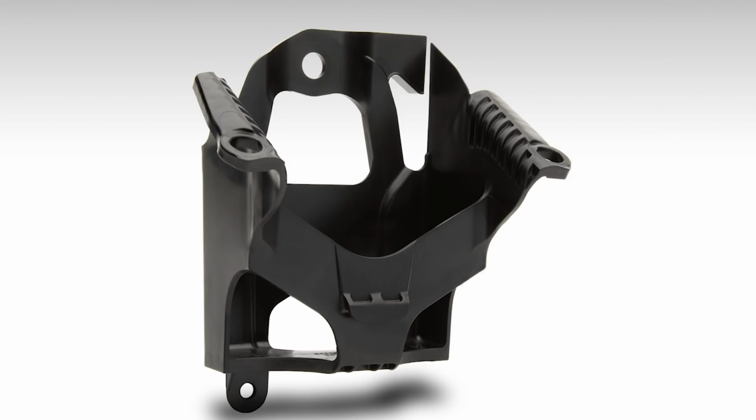Like the 450s, the battery has been repositioned 28 millimeters lower to drop the center of gravity. They basically redesigned the battery tray and lowered it into the airbox to move the battery and the weight associated with that farther down into the bike.